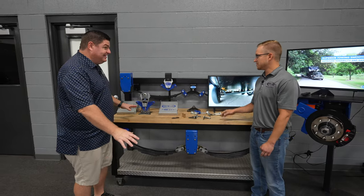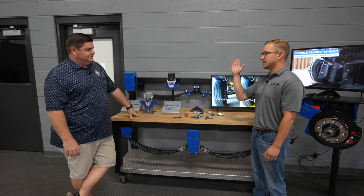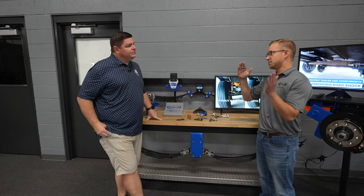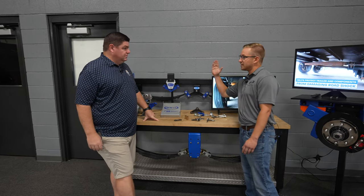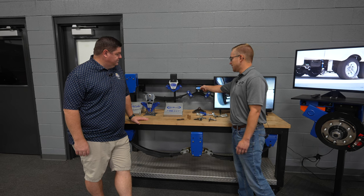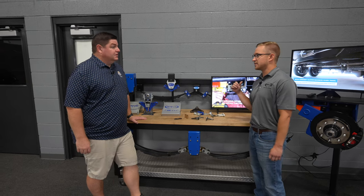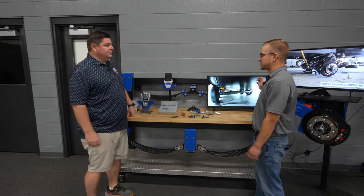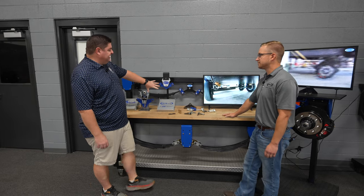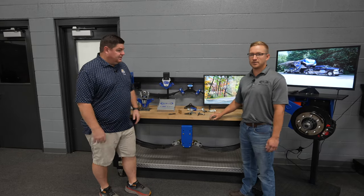Well, did I miss anything? So one other feature that we could talk about with these systems would be our cross members. You talked about the tire scrubbing and leaning. What that comes from is there's no lateral support in the frame in that section. So it's susceptible to twisting and tweaking, and your hangers are bending, and doing all kinds of stuff like that. We make a product that we call the X Factor that hooks in between the hangers side to side, so it gives you that lateral strength. The IS is built in with tons of lateral strength. It's already got the tubes that go across for the axles themselves, plus we weld in additional tubing, so you've got 4 points of lateral strength on the IS. But when it comes down to the leaf spring suspension systems, that doesn't exist, and that's where that X bracing comes in to help support that. You got it. Very cool, man.